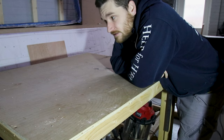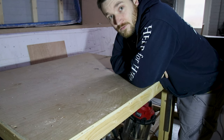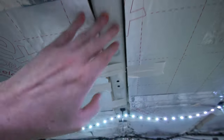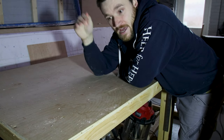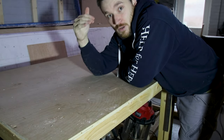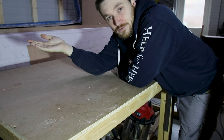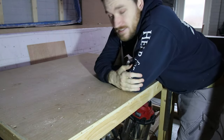It's a bit of a wet and blustery day again today so I'm hiding in the garage. Today we're going to be cutting down some strips of 9mm ply for the roof. I want to create a sort of inverted T-shape because we've used 50mm Celotex insulation in the roof, and where the ribs on the roof of the van come down they don't reach the full 50mm. So I'm having to create a batten along the rib to make it a little bit longer, then create the correct batten on top — both to wedge the insulation in and serve as something to screw the roof into. The obvious reason we're not screwing straight into the ribs is cold bridging; this is what you have to do to avoid that.